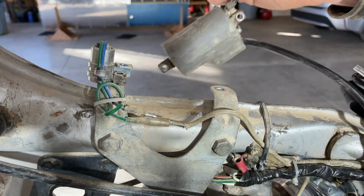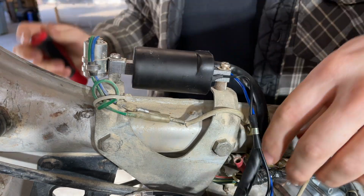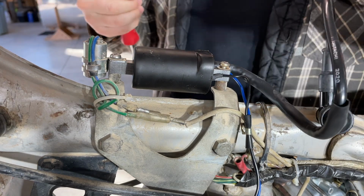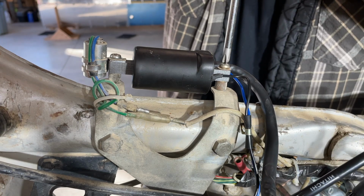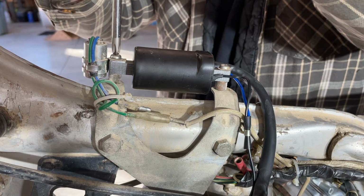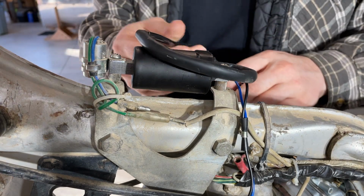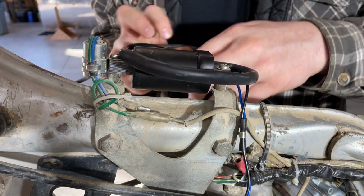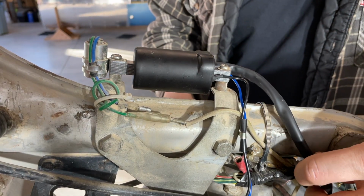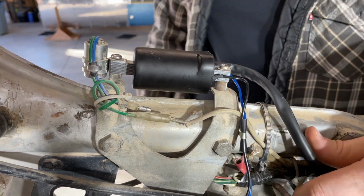Oh, that's just a spacer apparently. Plug wire says Hitachi on it. I feel like it's a good sign when the brand is a brand you've heard of before. Also a Japanese brand and not a Chinese brand. Not that China isn't capable of making good things, but generally when you're buying very cheap things, it's not good. This plug wire is a bit longer, so maybe routed a different way here around the back of the head. Nice solid click onto the plug.